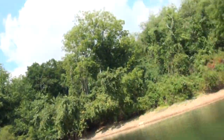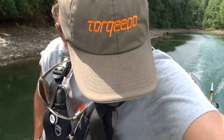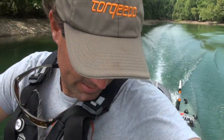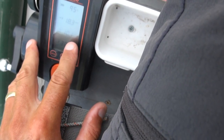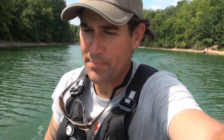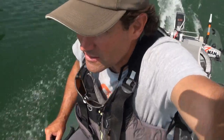I've already played around with the trim adjustment pin, tried a couple of different positions, touched 10 miles per hour briefly. Let's see what I can get on this run — it jumps right up. I'm going to scoot forward on the seat, and I may move the battery box forward even a little bit more. Pretty consistently I'm getting 9.8, 9.9, 10.1, and 29-30 watts. It's hovering right around 10. I think I am going to move my battery box forward because I had to really scoot forward on the seat to get that speed.